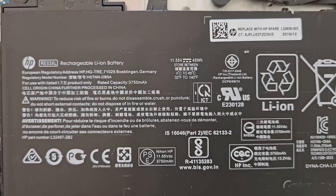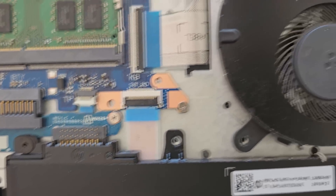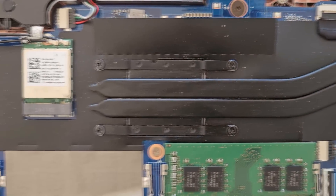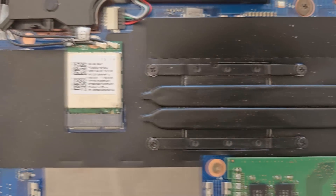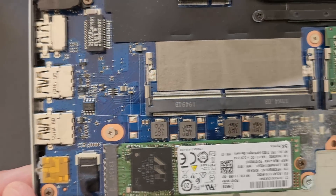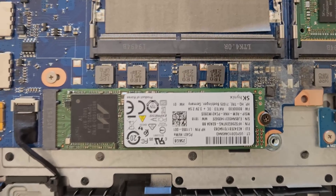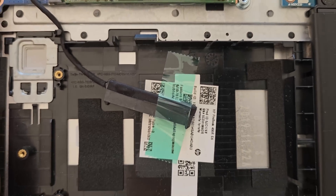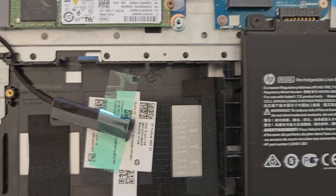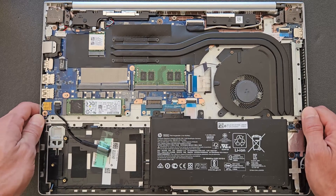There's a closer look now. There's your battery, just in case you're looking for a spare part. There's your CPU fan. The CPU is under there as well, and that's your Wi-Fi card. There are two RAM slots, both DDR4, upgradable. There's your M.2 solid state drive — at the moment there's 256 gigs in it — and that's your 2.5 inch drive slot which is empty. You have the option to put extra storage there; it's absolutely brilliant.